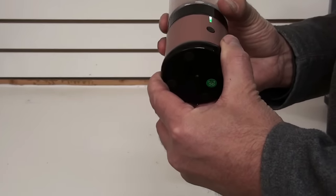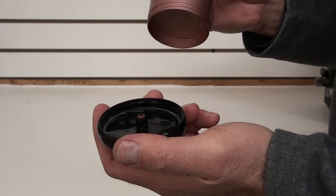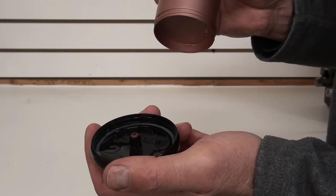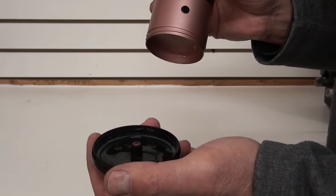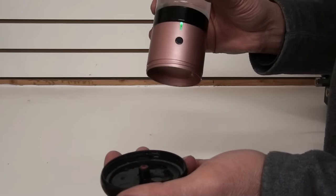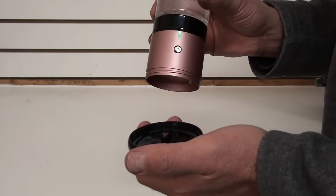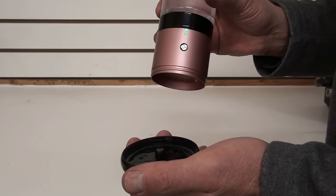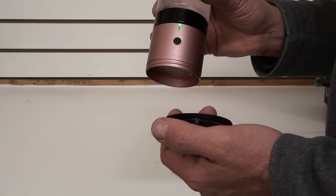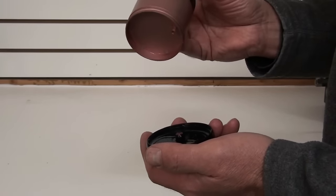Right here on the bottom, the bottom comes off, and in the bottom you'll have your wastewater. Now, the wastewater will contain O3, which is ozone, but most importantly, this bottle will take chlorine out of the water. So if your water that you start with has any chlorides in it — which means any kind of salts in the water — those salts will be converted into chlorine on the anode, which is the positive side of the electrolysis cell. With this unit, the anode is isolated from the cathode, which produces the hydrogen. All the chlorine and ozone are exhausted out the bottom of the bottle with the oxygen.